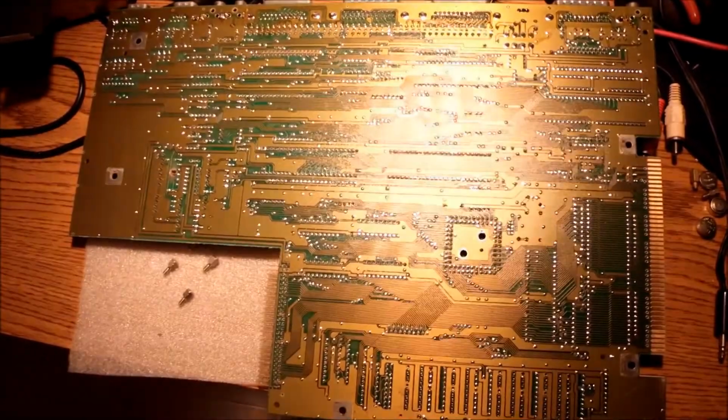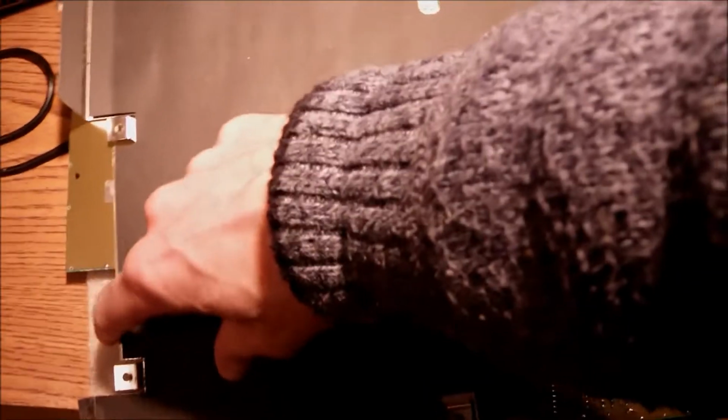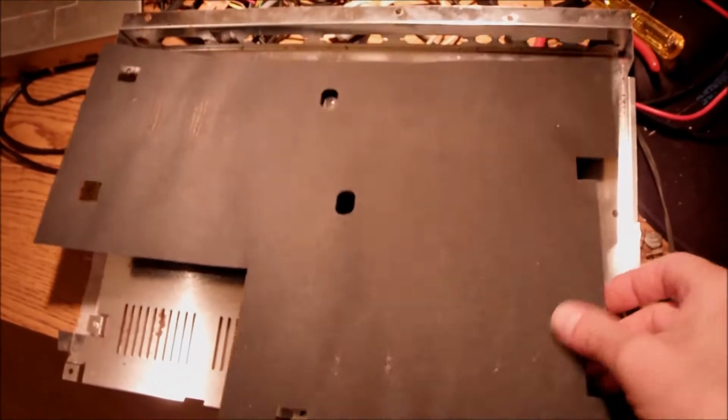At this point we shouldn't forget to check under the paper, which works as a non-conductive material in between the bottom part of the shield and the main board, because it holds every particle or dust or whatever, and protects the motherboard, so it doesn't get in contact with anything. The only thing, yeah, we should clean it too. The only thing I do not get really is why they have the ventilation gaps there while the paper sits over the gap.